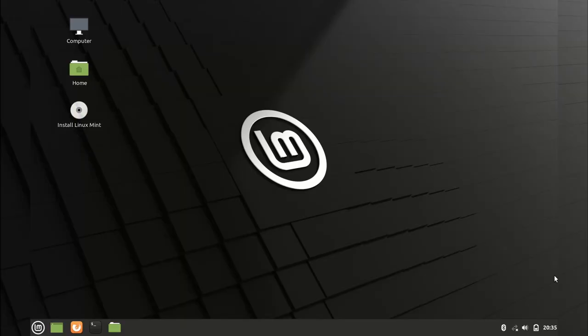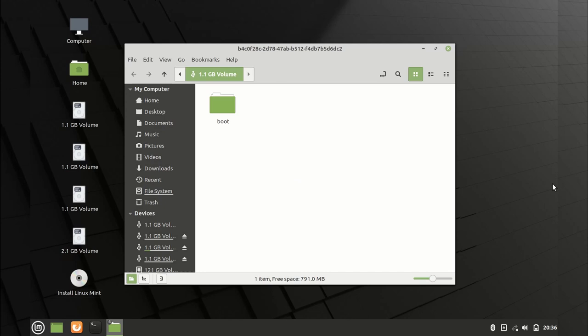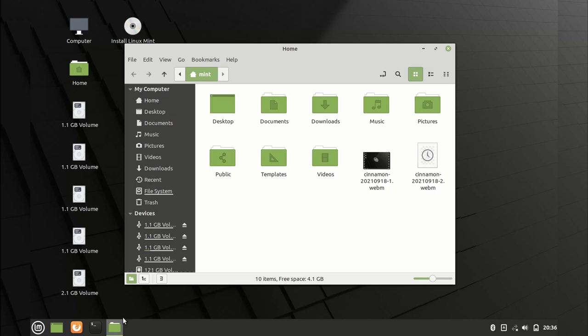We're almost there, so let's finally connect the hard drive. I plug in the USB cable and switch on the SATA adapter, and the drive powers up. Now after a few stressful seconds, it finally shows up, but to my surprise, it seems to have 5 partitions with only 1 or 2 gigabytes each. Luckily, in the file system I can locate the big partitions with 2 terabytes. Let's take a look.